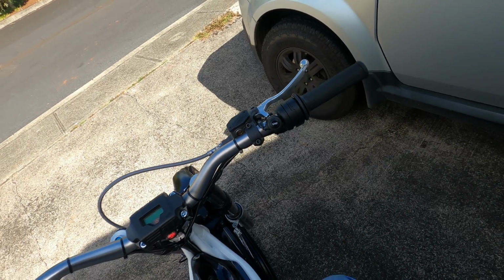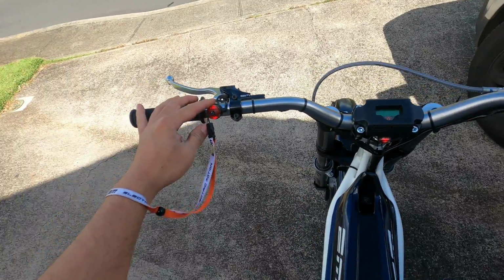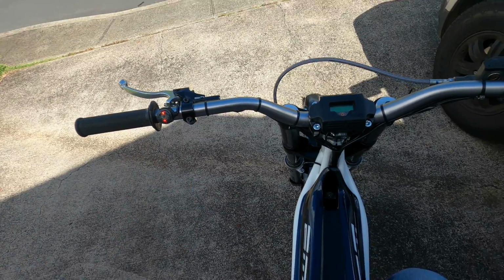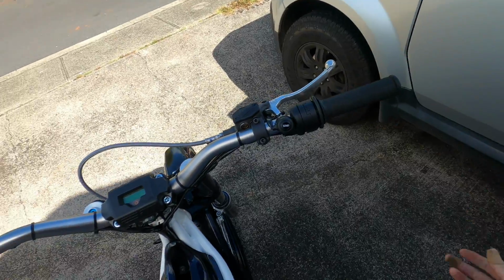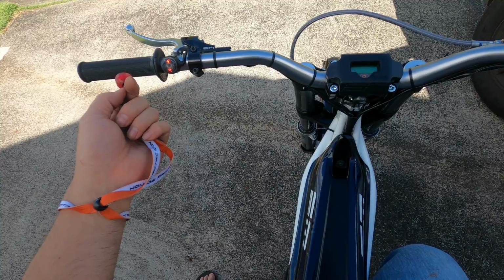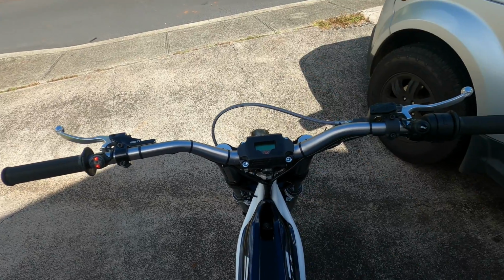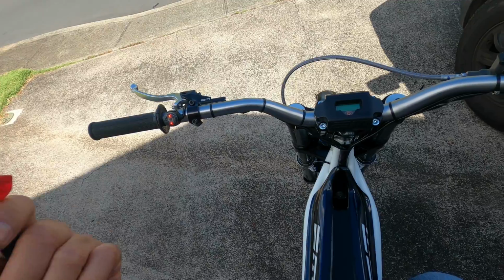So we recommend, because of the way the bike is designed, because it has this switch right here, whenever you stop, you always want to make sure you just pull this off. And what that does, it just kills the bike. If you loop out, it's not gonna run away from you. If you fall off the bike, it's not gonna jump up on the back wheel and land on you if you're going up a hill climb or something like that. It's just an extra safety thing.